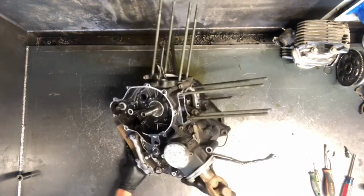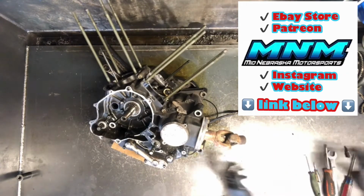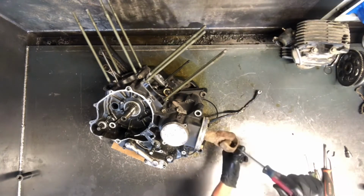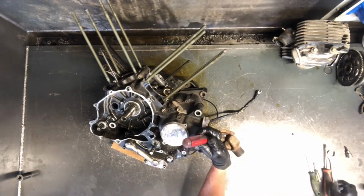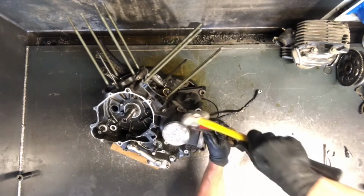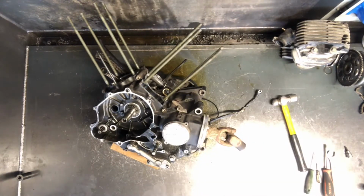To do another video on this yoke set because we have to remove that at this time. I've done several videos on yokes. This is a pretty common problem, for these U-joints to need replaced. So go ahead and grab a screwdriver. Go ahead and tap on the clip that holds that joint together. Sometimes it takes a little bit smaller screwdriver.